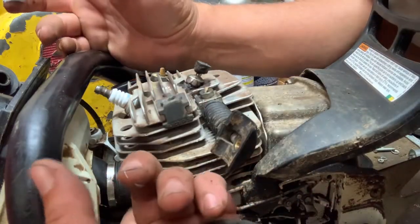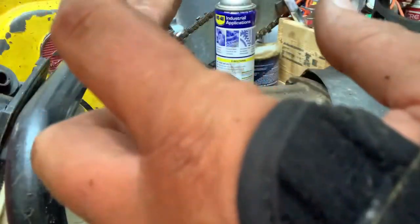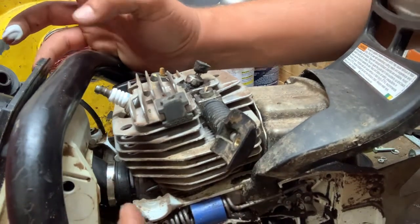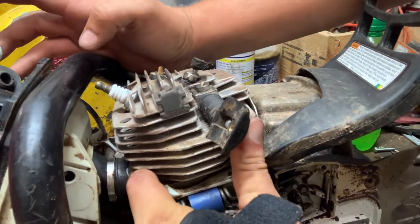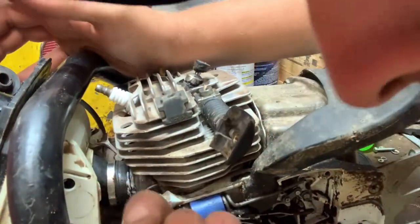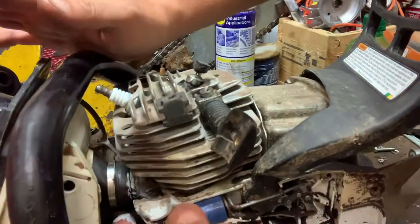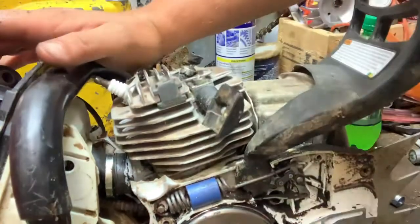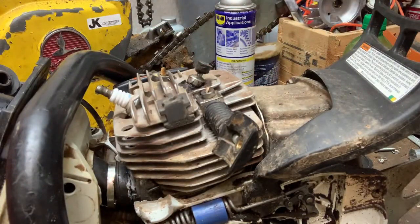And then, after we get it sealed up, we will go to drilling, and I think I'm just going to drill right straight down into the housing and drill a hole straight through the bushing that I've got. Maybe this should take care of the problem of the boot popping off. Which, according to him, is the only problem with this thing, is that boot likes to keep popping off. So we'll just seal the crap out of it.